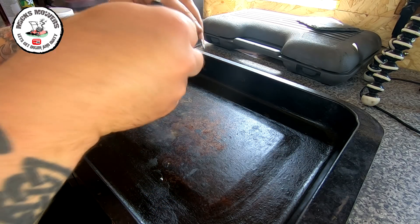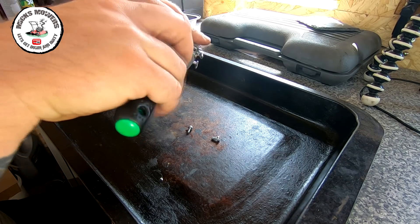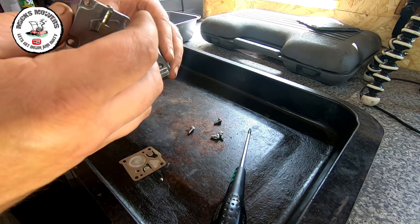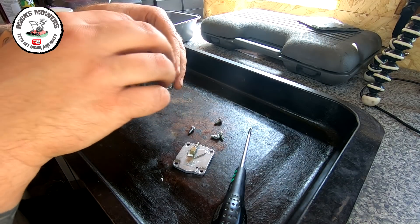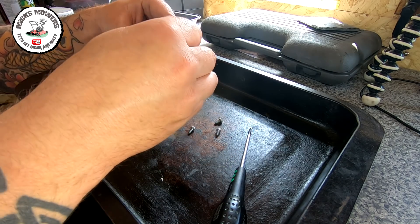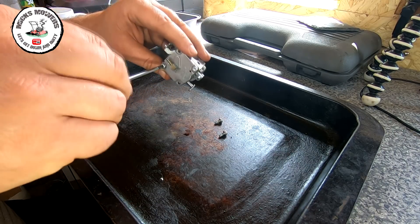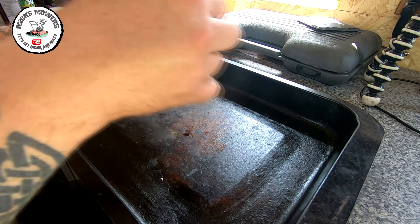We'll go over the bench and split this carburetor in half — see what delights we have inside. I think the carburetor has been cleaned but I don't think it's been installed right. So I'll start to undo it. Taking that off — we've got the reed and we've got the gasket there, that all looks fine to me. I'm quite happy with that, I'm going to leave that be. There's no need to upset anything if it all looks fine. The carburetor looks clean in there and it's definitely got a new reed inside. Some people get confused with carburetors, so it's best to take one part apart, and then when you're happy with it put it back together in the order it came.